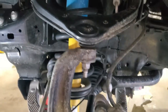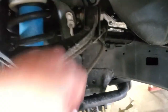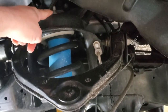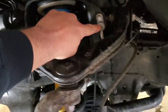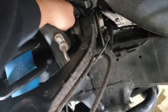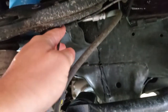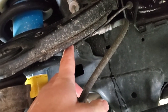So there's a couple things that are going to hold us back. Our goal is, well, remember, we're taking out this upper control arm. So there's two bolts that hold that upper control arm in, but they're going to come later. Other bolts, we've got three top hat bolts that actually connect the strut into the coil bucket. This is our brake line. And while he didn't reference that, I'm going to tell you that you probably want to loosen this nut. There is actually a metal brake line on the other side of this tab that we can pull forward a little bit just to make sure we get a little bit of extra slack. Your ABS wire right here, if you look, you'll see it's got a little alligator clip down here that's no longer gonna clip to your A-arm on the new setup.